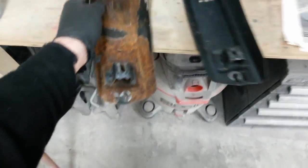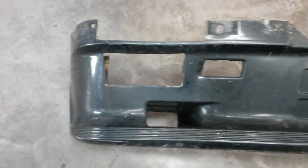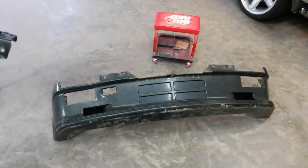If this gets too thin after it gets blasted, I may have to come in and weld in some reinforcements to keep the strength there, just around that bracket. I'll try to save this — he brought me another set of chrome bumpers as backup parts, but I don't know that it's going to be bad enough to go into that just yet, plus those are pretty rare and he wants to keep those. Next will be the rear bumper. This is the front valence — it's plastic so there's no rust problems, and I don't see any torn tabs or splits. It just needs to be cleaned up, and the main issue is getting the bottom straightened out.